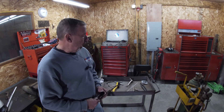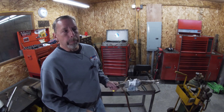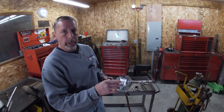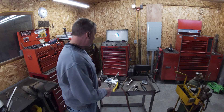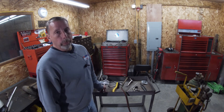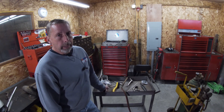By then everything was done with MIG welding, but I still like using the torch and brass. Years ago we used to do a lot of patch panels — trucks would rot out and you're always putting cab panels in and rocker panels — and brass was just an easy way to do it. You'd flow that brass in; it was easier to clean up than a hard metal weld. It had its purposes. It's not recommended anymore with the high-strength steel and all the coatings they put on metal — you do have a big heat-affected zone.